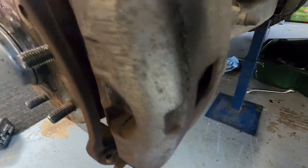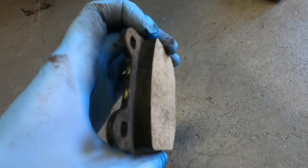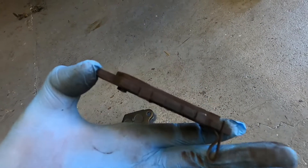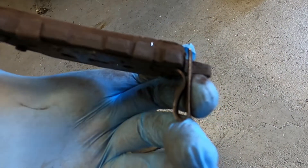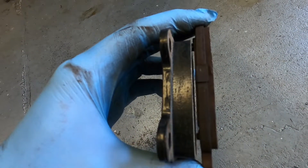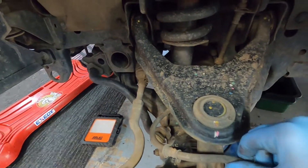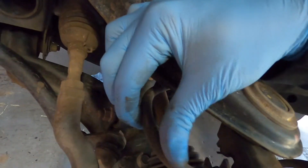Here's a new pad just to give an indication of how much is left on these. The worn ones are probably down to about 20% left of pad material - you can see the wear indicator is virtually at the same height as the pad material. These ones don't need to be replaced but I'll let my mate know they'll be due at the next service. While you're in here, check your brake lines - make sure they're nice and soft with no splits or cracks, go around with your hand and a torch.